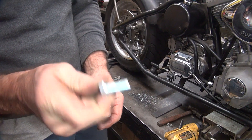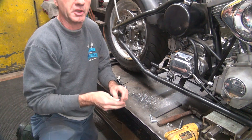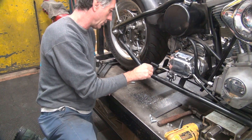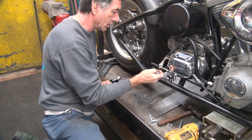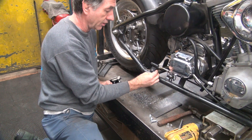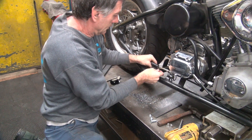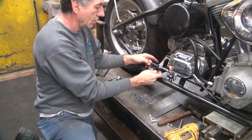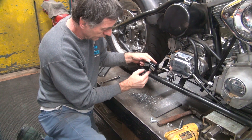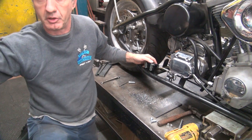Alright, a couple of bolts. For lining stuff you use fine thread. You use coarse thread when you go into aluminum or stuff like that, or when you need quick removal. Fine thread's stronger. So that's going to be there. I think I'm going to put the bolts in from the back side — that way we don't have the bolts sticking through eating through your brake line. Might be an important thing you probably wouldn't want to be doing.